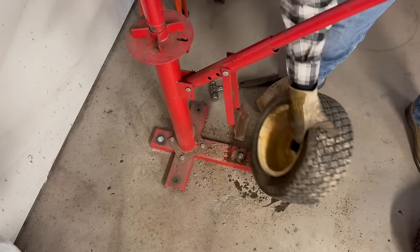Well, we got the transaxle fluid change. I'd like to do the engine oil next, but before I do, I'd kind of like to run that engine for, you know, 5-10 minutes, get some heat build up, and hopefully get all the bad stuff picked up in the oil before I drain it. And when it's hot, it's going to drain out a lot easier.